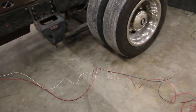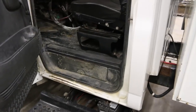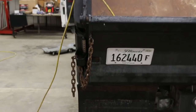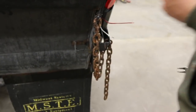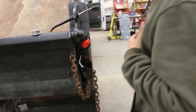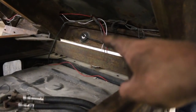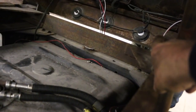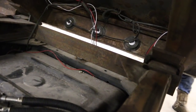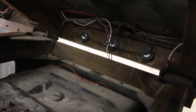That's pretty much what we're working with. And then we're going to have to run another positive back here to these floodlights — that one will come up in here to a switch and then again go down to the battery. So we've got the driver's side mounted up. We're working on the passenger's side now. We've got to solder these three connections and then put our bolts in. We're going to solder those wires — that black, red, and white — that's what's running over to the driver's side light and that's what's running up to the switch. We're going to solder those together as well and then all the back connections will be made.